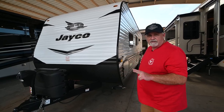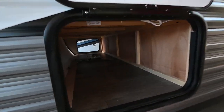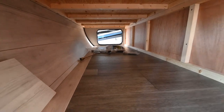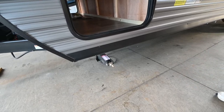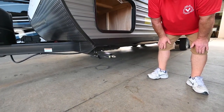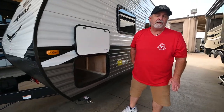This is a pass-through storage compartment — nothing to operate in there. That gold handle on your left is what you use to lower your stabilizer jack. It slips on and you crank it. When the foot of the jack hits the ground, give it about two and a half more turns — that's enough pressure to stabilize it. These are stabilizer jacks, not leveling jacks. Do not try to level with them — they will bend, they're not designed for that.